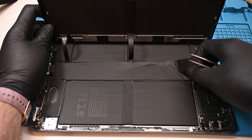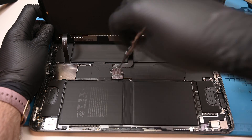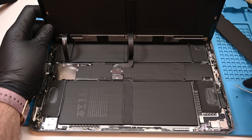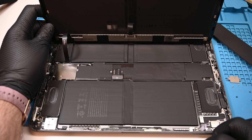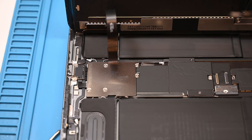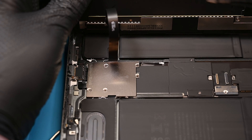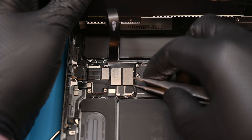We've got to disconnect the battery and these display ribbons, in that order. First, we'll peel off this absolutely large graphite thermal pad that covers the entire board, which reveals even more graphite stickers below. Disconnecting the battery is as simple as removing the single Phillips screw. Just above that connector is a shield holding some display ribbons down, held in with two more screws. Once removed, you can use pointy tweezers to pop the connectors up from the board. I'll be redoing all the adhesive, so the display needs to go.